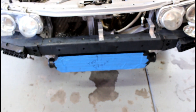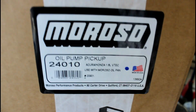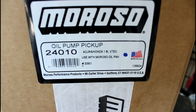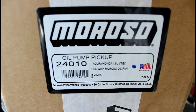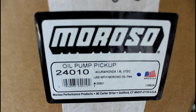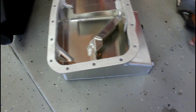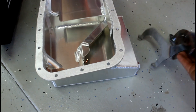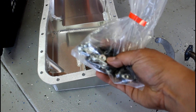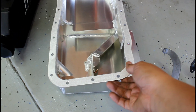Here's the LS VTEC part number — if you have a LS VTEC with a girdle, you use this one which is the VTEC version. If you don't have a girdle, you use the LS one. We're in the process of removing the factory oil pan and installing the Moroso oil pan and Moroso pickup. It came with a stud kit and has a turbo oil drain built right in, which works out nicely.